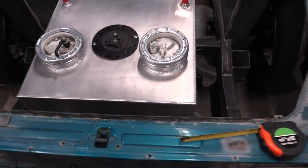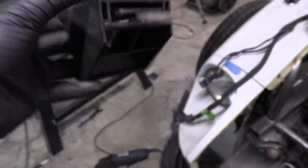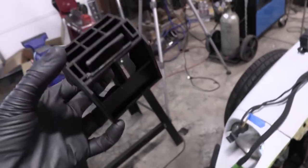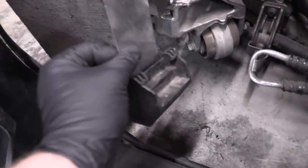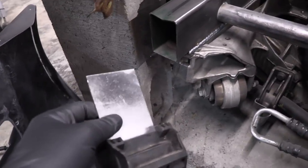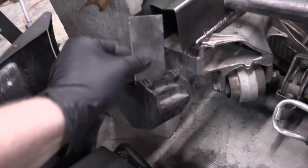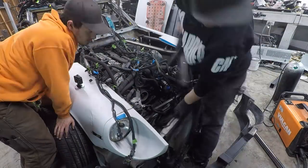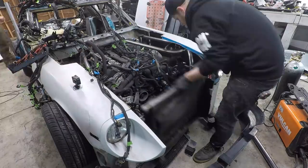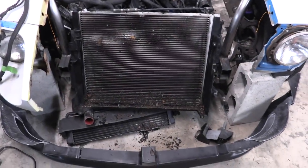Moving over to the cooling system — this plastic piece has a little shelf that holds the radiator as a slide-in lip. These tabs need to get welded 32 and a half inches apart on the frame. Our frame rail isn't fully built yet — we haven't designed the finished front section — so we'll weld them on temporarily until we design the rest of that frame rail. The radiator will angle up and connect over here to a removable bar we're going to build across the front.